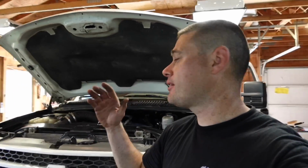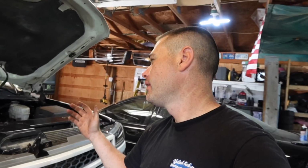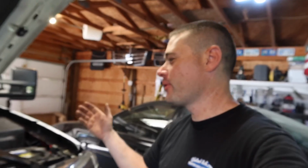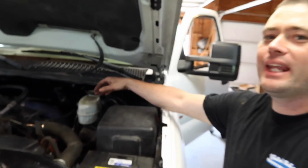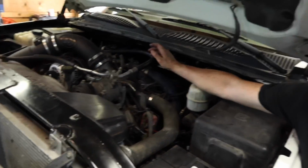Okay, hello everybody. I'm back. It's the very next day. I turned the camera off because I wanted to diagnose it. It was showing a fuel pressure regulator code and nothing was disconnected, so it took me a while to figure it out. I actually had a friend of mine walking in the garage just seeing what I was up to, and he's like, disconnect these top harnesses up here. And I'm like, I didn't mess with that. Doesn't make any sense. But I did. I disconnected the two top main connectors up here, plugged them back in, and the truck fired right up.